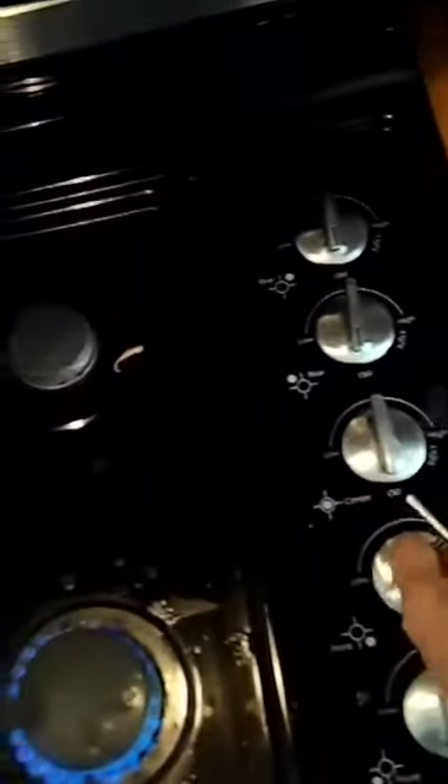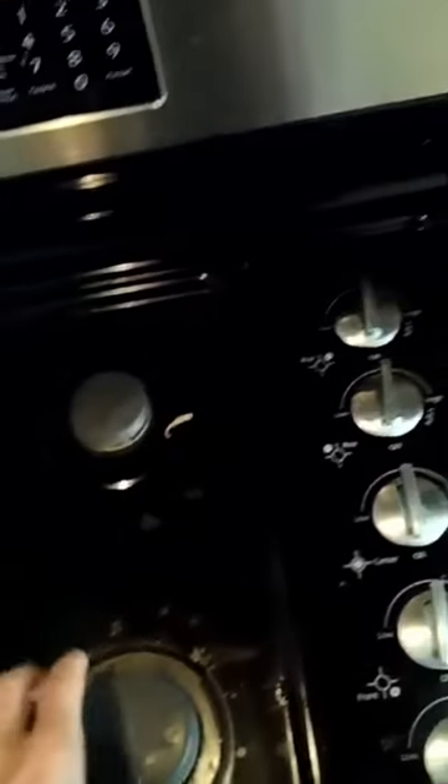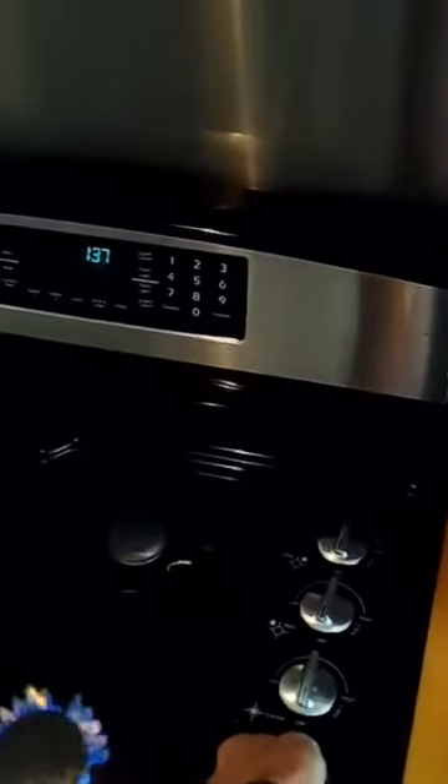The method that works the best is to take something sharp and poke it down into this little central hole. Sometimes it's a ways down, maybe an inch down. There's a little brass piece called a jet, and if you use an extended paper clip and wiggle it around in there, it'll knock out any obstruction that might be in there. And then you...